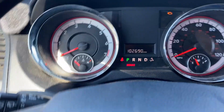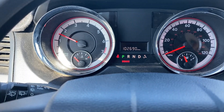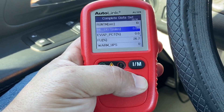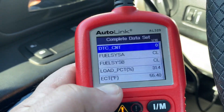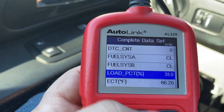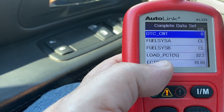What you have to do is start the vehicle when it's under 120 degrees, and then warm it up until it gets to 165. The engine coolant temperature is on the very front page right here — currently it's at 56 and climbing. There are a total of 46 fields of data available at the very top, and the engine coolant temperature is the fifth one.